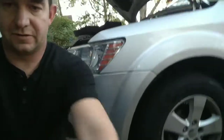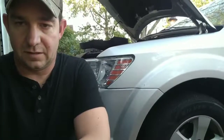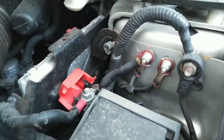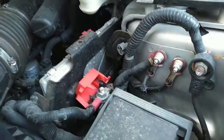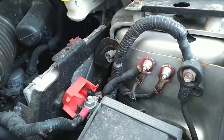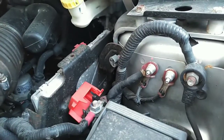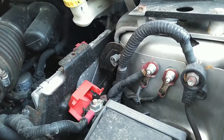The battery is in front of the driver's side wheel well, so you can either take that cover out and disconnect it there on the driver's side. You've got your negative lead here and your positive there obviously, so take the negative off first. Disconnect it there and use a voltmeter to check at the feed on the back of the alternator to make sure we don't have power.